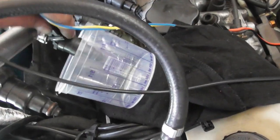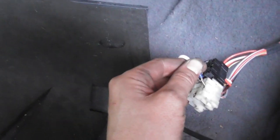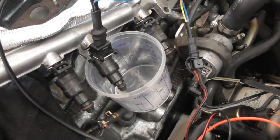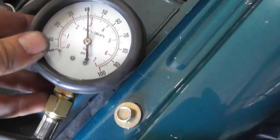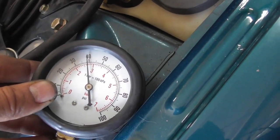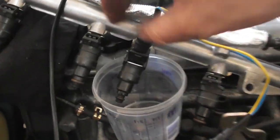Made a bit different setup here. Prime the fuel pump again. Make sure we have 3.1 bar — yes it is. Hit the button. 2.6 and a half — that's okay. It should not be more than 0.1 bar difference between each injector. I'll go for the last one.